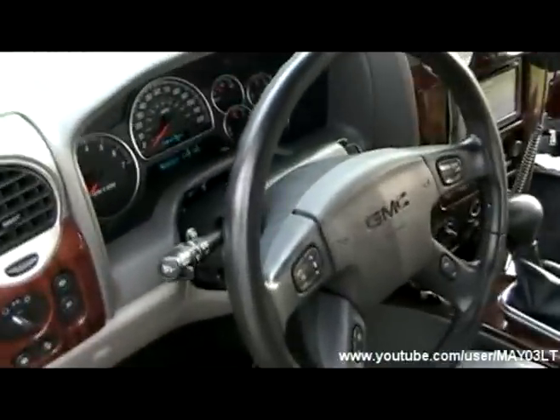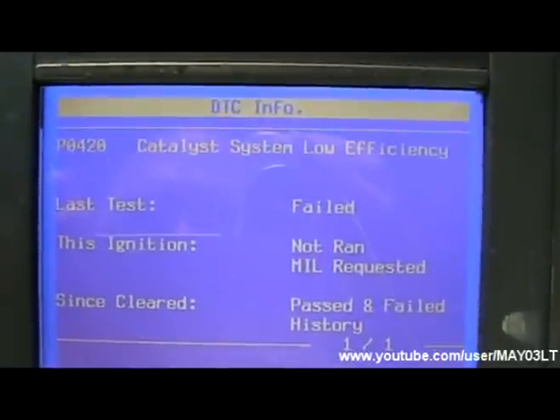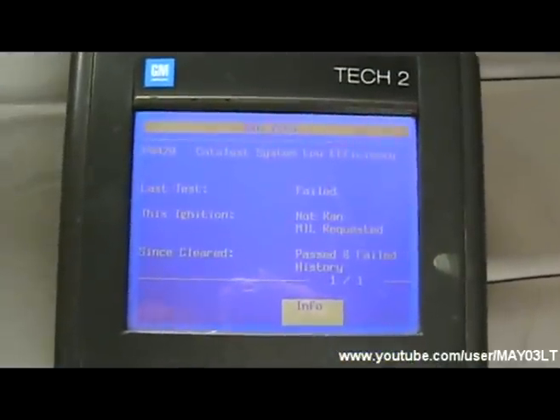When I get them here, I don't guess. The other week my buddy stopped by with his '02 Envoy. I'm going to show you some footage from me determining that his catalytic converter was failing. Alright, we've got this 2002 GMC Envoy - the problem is the check engine light is on with P0420. I'm going to show you just what I do for a preliminary P0420 check.